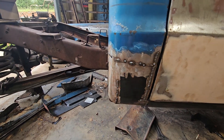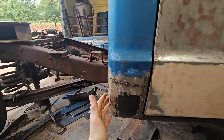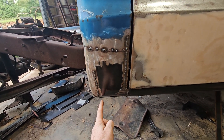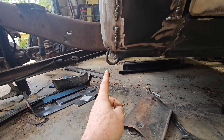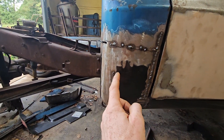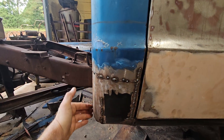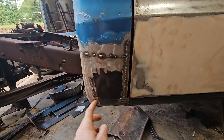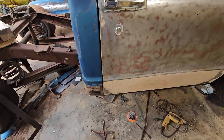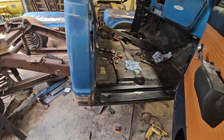When I put a straight edge across the back, it was out — not an optical illusion. So we had to cut it here, and then I welded a ratchet strap here and hooked it up there so I could cut it and put some pressure on it to pull it in tighter, kept trimming until we got it in line. Now I've got to finish welding that up, but it's coming together — the door closes nicely.